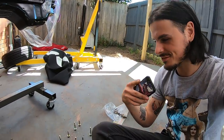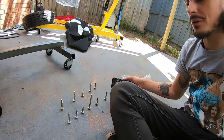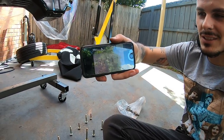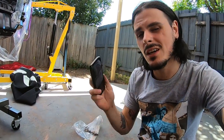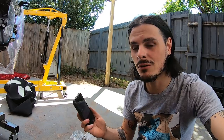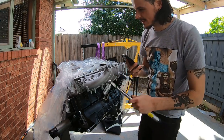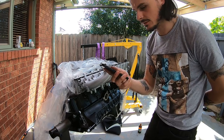If you have memory issues like me about which bolt length goes where, what I did back in June when I stripped this off was take a picture of it, so I can line it up and know exactly where each bolt goes. When you feel confused about something, always take pictures — it will save you in the long run instead of searching the internet. You're going to need two torque wrenches — a long one and a short one. The newton meters for the nuts are 11 to 13.